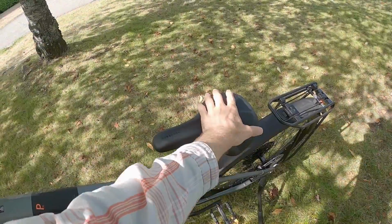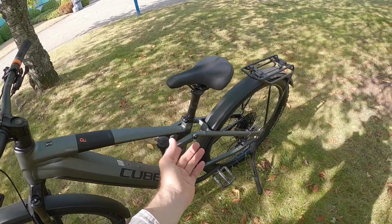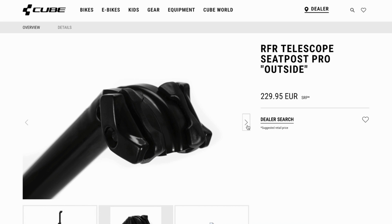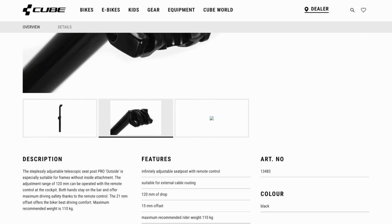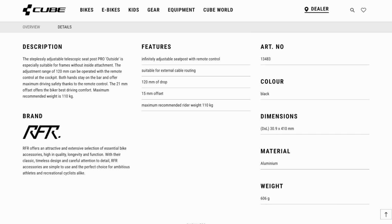I found the saddle to be pretty comfortable. Sequence, 30.9mm seat post, not super relevant since we do have front and rear suspension. But another trade-off is that this is not a dropper post. So mounting the bike and maybe standing if you get onto rough terrain and using your legs like shock absorbers, that's a rigid post. So if you're getting full leg extension, that saddle is going to be pretty high all the time unless you swap it out yourself.